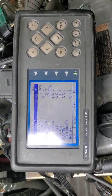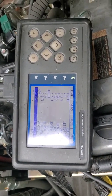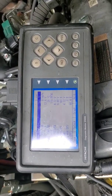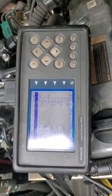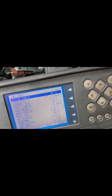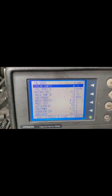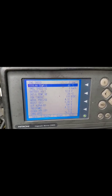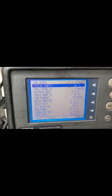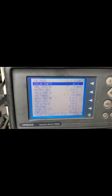What I'm going to do is attack this coolant temp sensor and coolant temp sensor circuit. I'm going to unplug the sensor, and what should happen is that 200 degrees Celsius should go to a default value. I got the sensor unplugged, and you see it went from 200 degrees Celsius to 40 degrees Celsius. 40 degrees Celsius is about 103 degrees — that is this particular ECM's substituted value for an open circuit. I'm just going to plug it back in and you see we got 200 degrees Celsius again. Unplugged — 40 degrees Celsius.